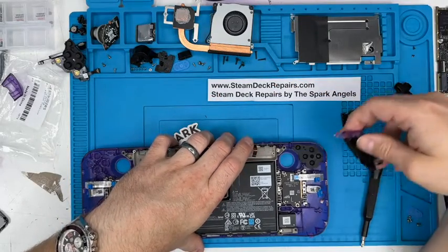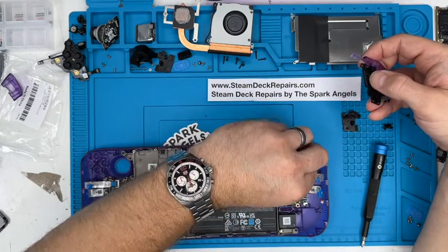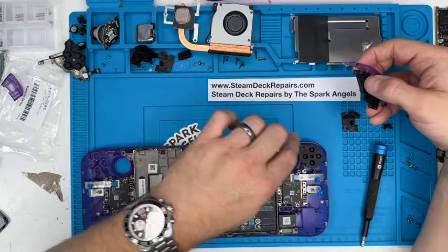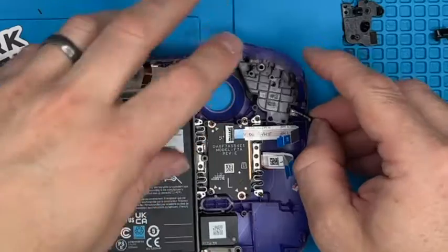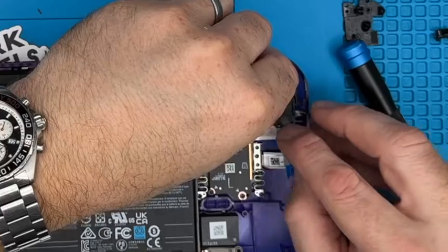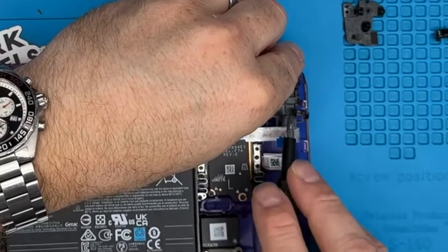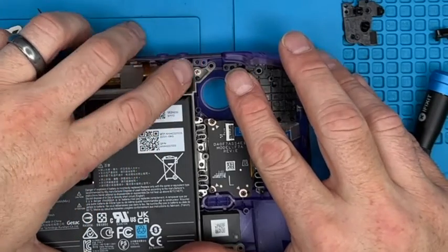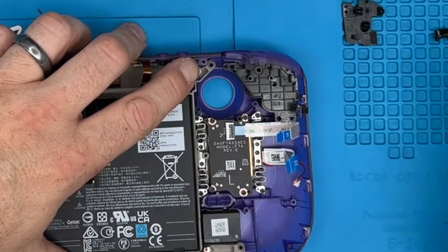So we put the rubber membrane in place right there. We've showed you that before, but we'll make sure the buttons are all in place. You don't want to get there and spin it over and the buttons aren't there. There's a little spigot that follows through and goes around that hole as well. Then the bumper button, we're going to line up onto this. This bit has to go underneath there. There we go. Yeah, okay, so we get that under there located, then that touches in, then the rest actually falls into place. There we go. That spigot, button's nice and operative. Then we can put some screws in.